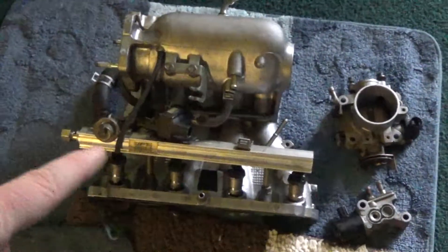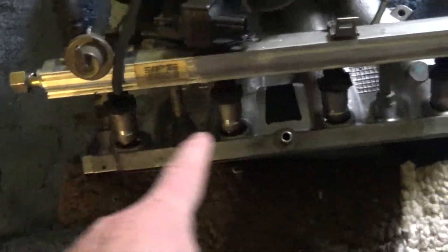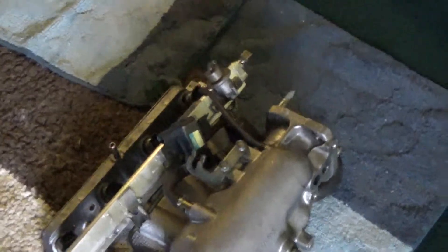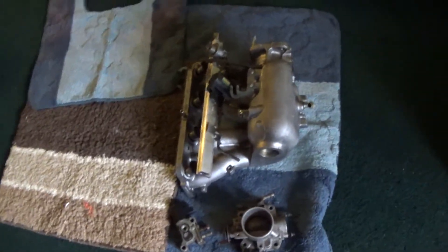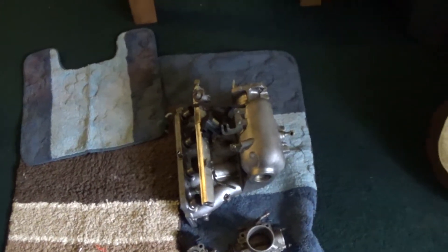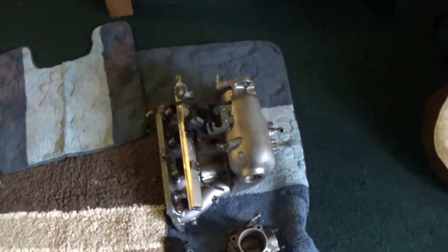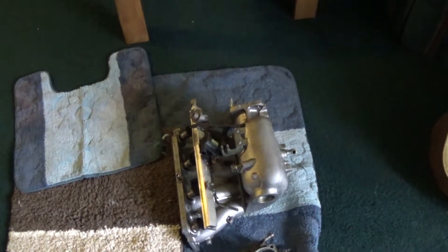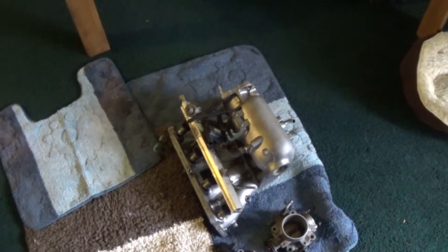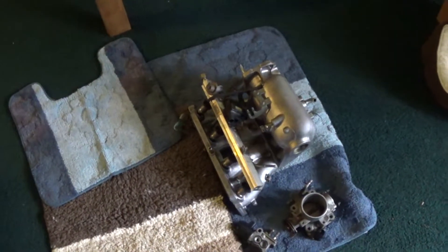What I'm gonna do is take off that fuel rail, get the fuel injectors pulled off, and save parts like the heater hoses - those little things cost you money because you want to get the fitted ones. I talked to my machine shop today - I'm gonna have them hot tank and inspect all the parts. They said it'll probably cost $150. That intake should come out really nice looking clean.